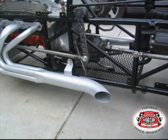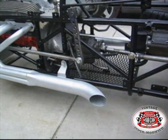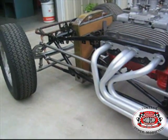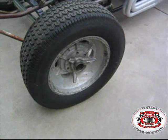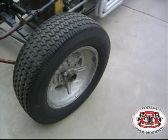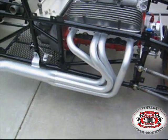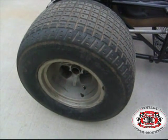I haven't finished the clutch linkage yet. That's about the last thing I had to do mechanically, other than take the engine apart and rebalance everything. It had a foot clutch in it and that was quite challenging to get all that to work. I've still got just a little bit to do there. I am also missing this left front Nance knockoff. If anyone would know where there was one at, it's a steel knockoff and that's the only one I'm missing. I've got to get tires for the car. I need a right rear wheel too. I have a right front and left rears, but I need a right rear safety wheel with a 3-inch or 3.5-inch offset, at least 10 inches wide.